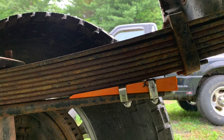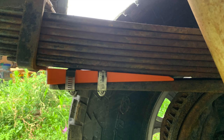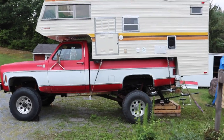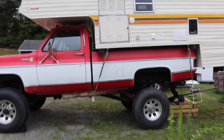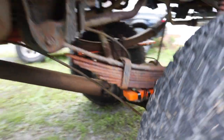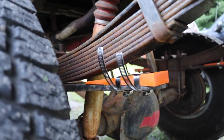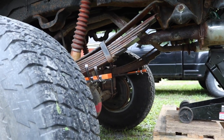The results from the felling wedges at this location were minimal — very slight improvements, barely noticeable, and it was still not safe. It still swayed. When doing this modification on the rear springs, you need to get the springs completely unsprung. This is about as far as I want to go with the jack — it gets a little sketchy. You can see where I had them wedged before and how much room there still is — so we're going to get these cinched in there harder.